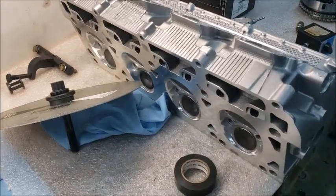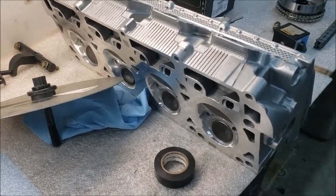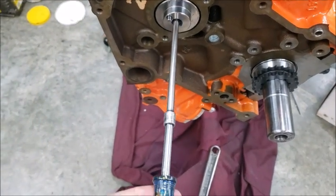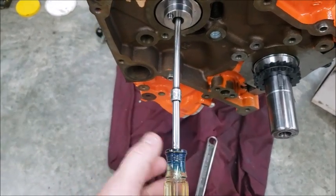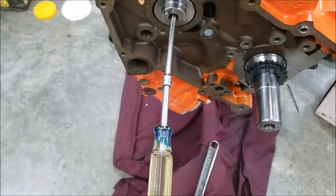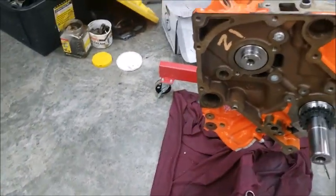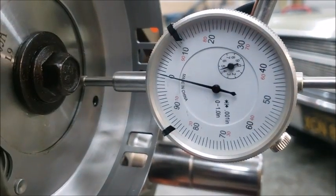When you're doing valve clearance, I don't do the clay method — I do the valve drop method. Here's a little tip: I'm putting it in so you don't nick bearings. Put this in there so you can hold it and leverage it up, using two hands to put these in. It just helps getting it over that last little bearing — put it in really simple. Nice little tip.